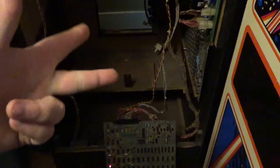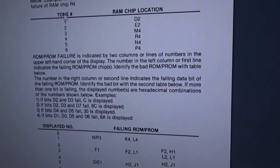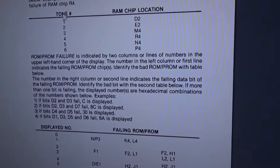Okay, that was one high, two highs — and then damn it — high, high, low. So it passed the first chip, it passed the second chip we just put in, and now it found yet another bad RAM chip. Let me hit the self-test again. High, high, low — consistent. Looks like we have more bad RAM. If the third tone is low, the manual says that M4 is bad.